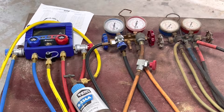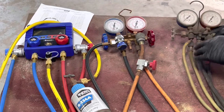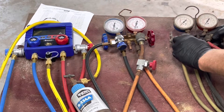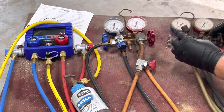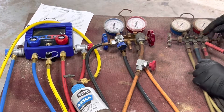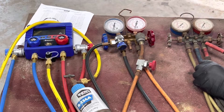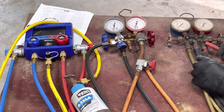Taking care of your vehicle's air conditioning system used to be easy. Up until 1993-94, all cars in the United States had R12 refrigerant, and you needed a set of manifold gauges with the low side and the high side. You just put this on the adapter on the car, plugged it in, turned the AC on, and the gauges moved — or they didn't — if they had something to do either way.